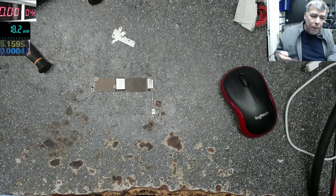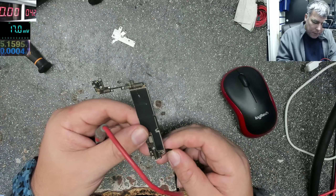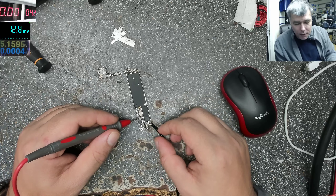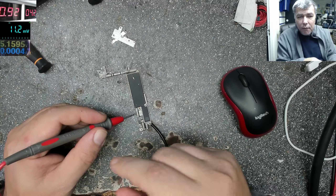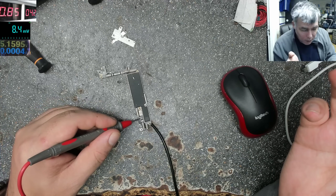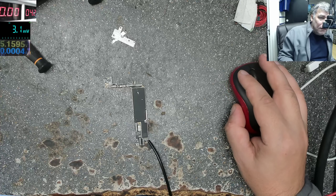Normally I will not start a video just for a short capacitor or things like that, but this is interesting. So if we check the board - obviously that's the first step - you see it's not charging, it's not doing anything. What you do first: you connect the power supply, which is now on 4.2 volts on the plus pin of the battery connector. And it's taking like 1.3 amps at 4.2 volts - so it's not like a short, but the phone is drawing too much current. It's off, it's not supposed to be drawing that kind of current according to the schematic.